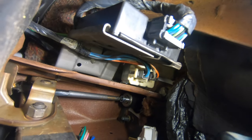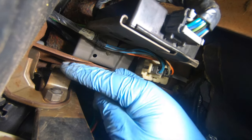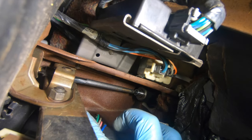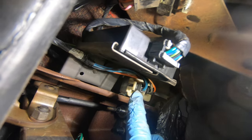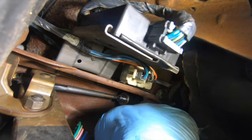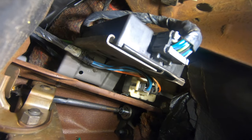After a not insignificant amount of swearing, this bar is put back on that comes from the Hydro Boost unit. The cotter key that's underneath there goes on. This bracket goes on. You tighten it down with this bolt — it's just a bolt that goes through, so it's not captive. We needed to remove the AC control box in order to remove the relay in order to get to the other bolt that's over here behind all that stuff. So all that stuff's back in and the brake feels good.